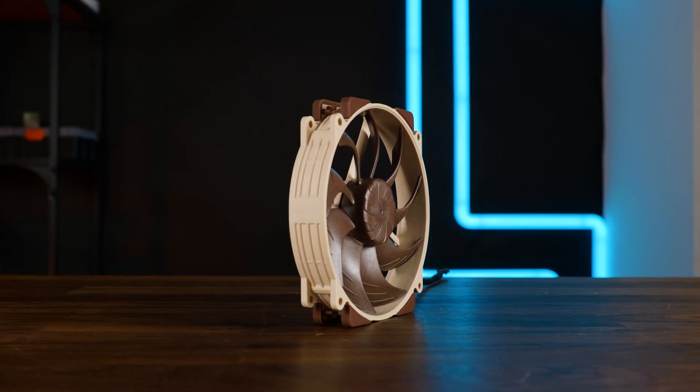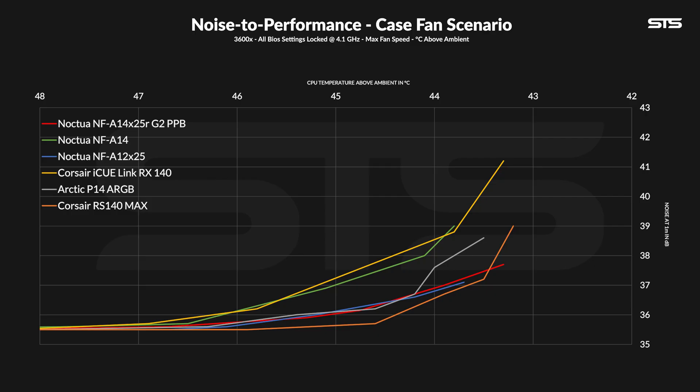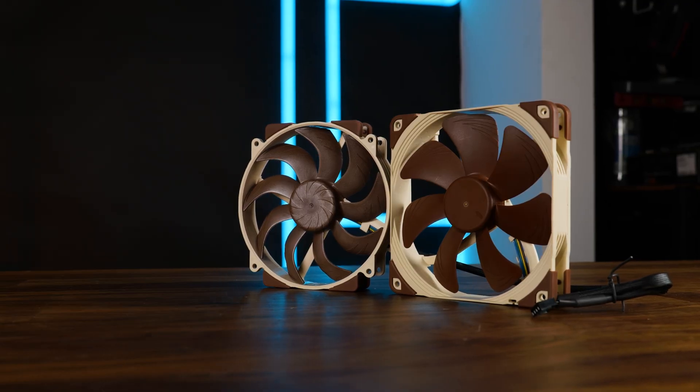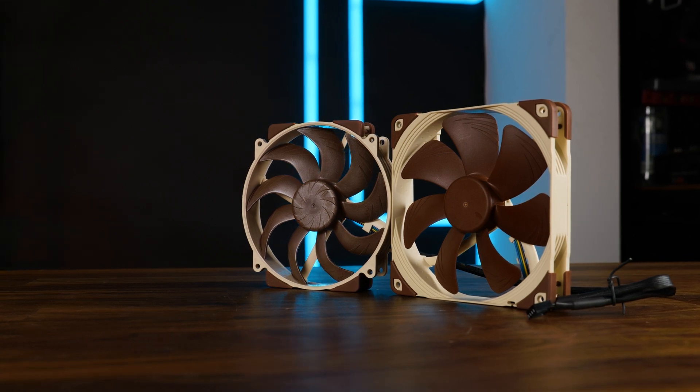We made them spin slower and slower, and we measured both the performance and the noise along the way to get this graph. The first thing that caught my eye is the huge difference between the max noise of the original A14 and the new one. This seemed off to me, as Noctua says the new ones can be a tick louder at high speed, but my dB meter said no. I'm not saying Noctua is wrong — it can also be that the original A14 I used has some sort of defect because of time. It has already had its fair share of fear and terror. The big issue when measuring with a dB meter is that usually they are weighted — like dBA, it's A-weighting.